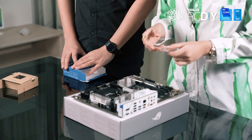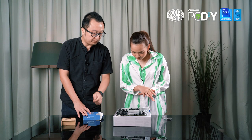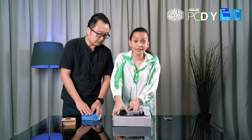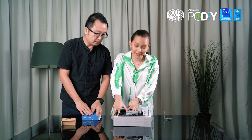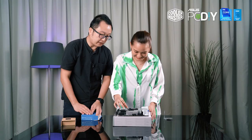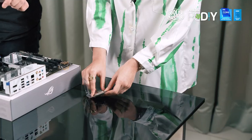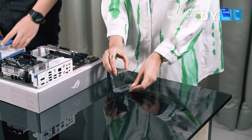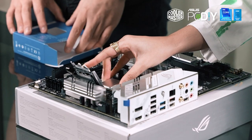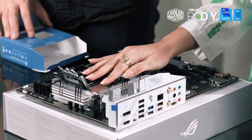Is it here? Yes. You want to open the pin — you press this pin and then pull out. Yeah, pull out. Alright. Anyone who wants to build a PC, call me, okay? Just call me. Open this up — lift and then open it up. So now you slowly put down the CPU, just put it down. We need to push down. Align the box. Yes, like that. My hands are already shaking — I'm scared. Leave it down and then just wiggle to make sure it stays in the socket.